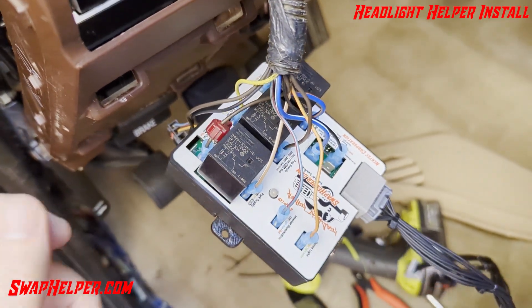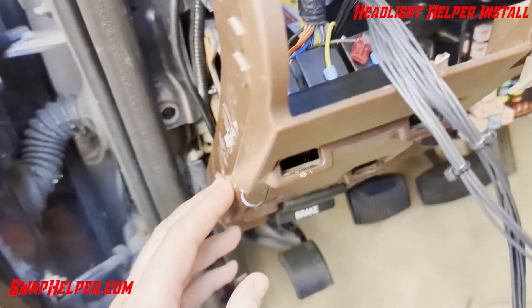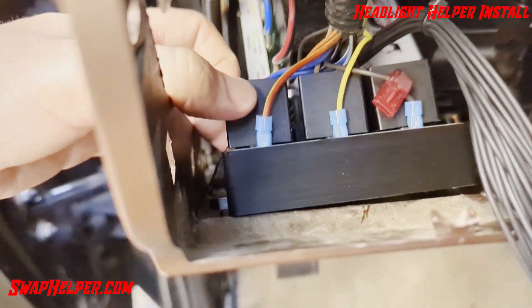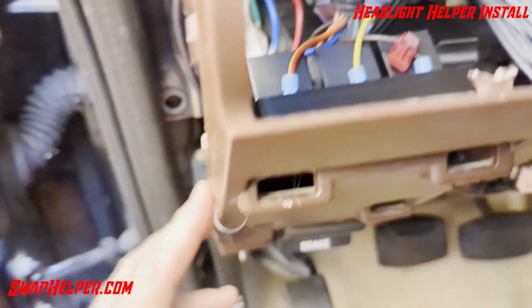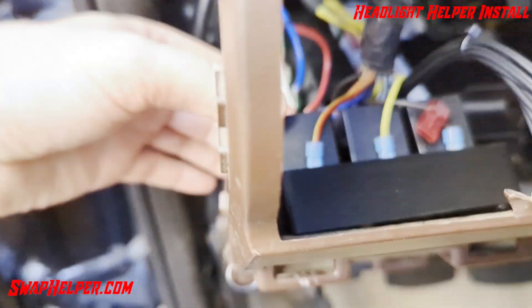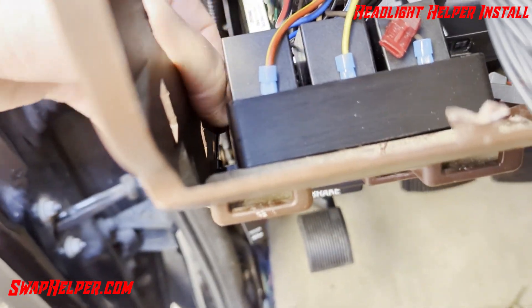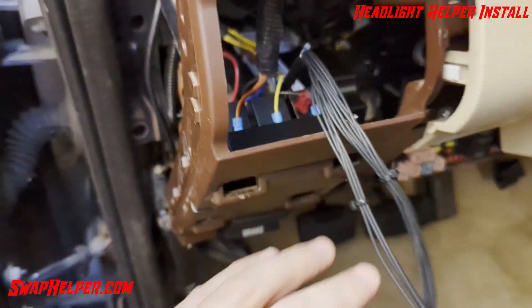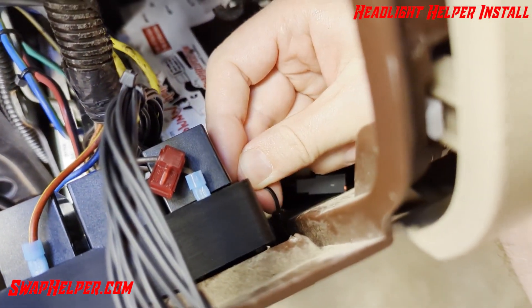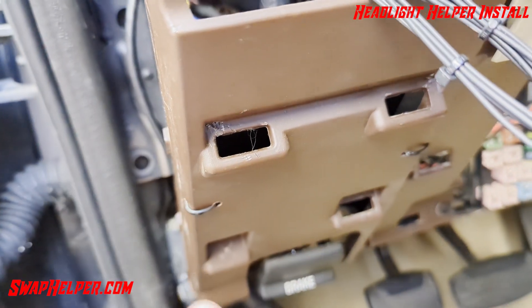Now get the unit in and get the zip ties loosely installed. The two zip ties go around — the Headlight Helper is in position with the two zip ties coming around either side. Make sure you put the head of the zip tie on the inside because you don't want anything to obstruct the end cap when it goes on. These will be tightened down and pressed up against the edge so they won't impede the installation of the end cap. Pull the zip ties nice and tight so they lay down flat against this portion and the end cap can go on. Bring the connectors out that are going to connect to the headlight switch itself.